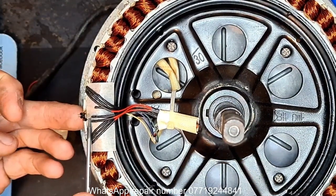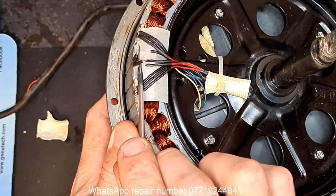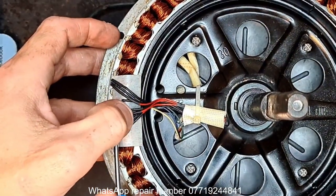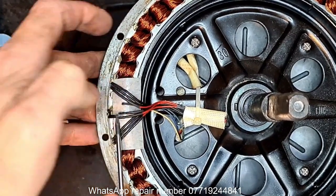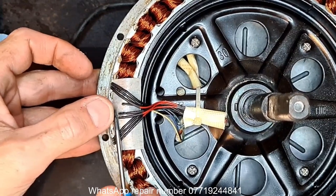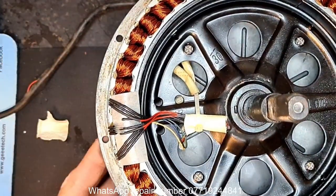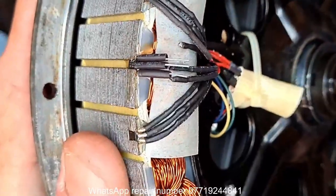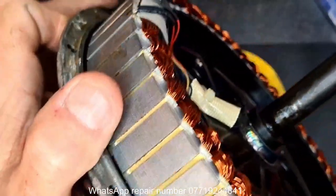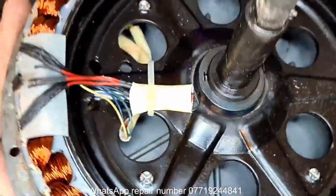So I'll just put something underneath the actual pin like that, and then I'll bend it over the actual head of this. So there you go, there's one, two, or three. So we've got them in, we'll shrink the heat shrink down. We've got a bend on the pins so they're not flexing. Now we just need to dress the wires on the other side.